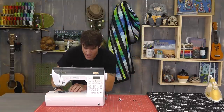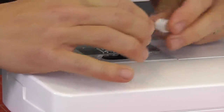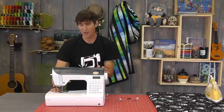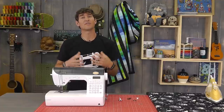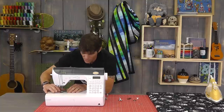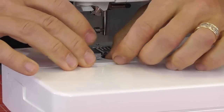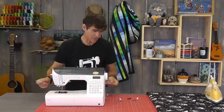I've got a couple of screws that are coming out here. I'm going to open my little bobbin door and take the bobbin out. Now all of these drop-in bobbin machines are similar but also different. This happens to be a Baby Lock I'm working on right now, and so the stitch plate and the bobbin cover area are going to come off in one piece — though I've seen them come off in two pieces. This is also going to be in the maintenance section of your owner's manual. I pick it out from the back first and wiggle these two parts loose. So they're going to come out in two pieces.